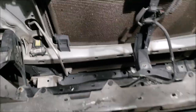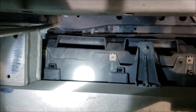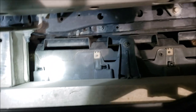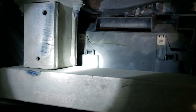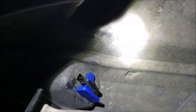Now we're gonna look straight down — you've got to take all that stuff out because you need to verify that those clips are clipped the way they're supposed to be. See how it's got a little tab — it's actually kind of locking it in place. It's not a very secure fit at all, which makes a lot of sense why these pieces come off so easily. It's got two corner tabs that are under that vertical piece — you're gonna have to feel in there and make sure they're pulled in, or your piece is going to be sticking out at the bottom. Find where those blue clips go in that little corner — it only uses one blue clip per side.